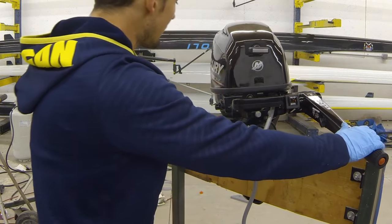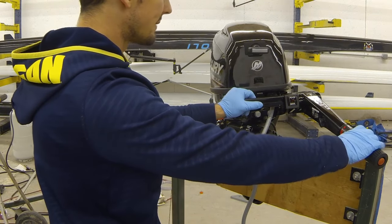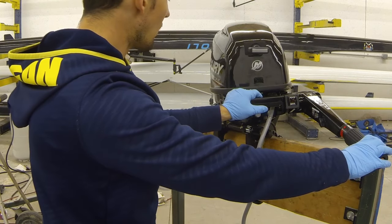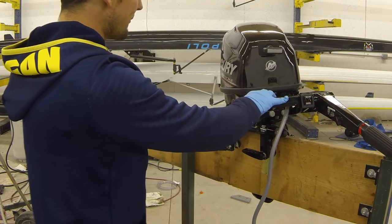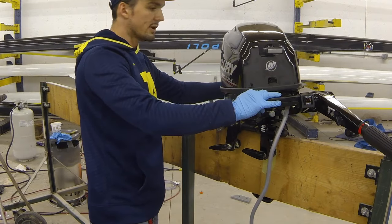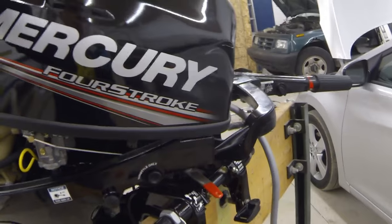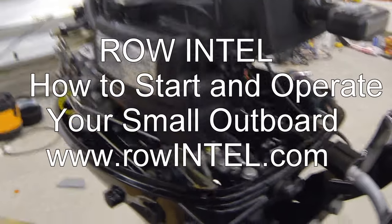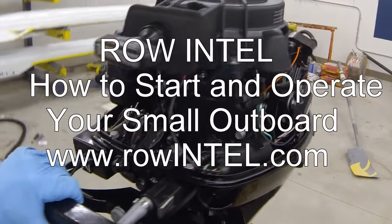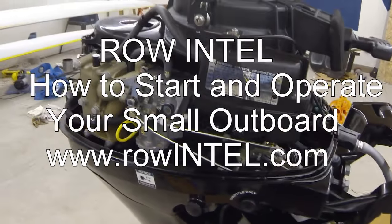So that's the basics of it. For some more advanced videos, you can click on the link inside here and look at other ways if you have a stubborn motor that's not starting up, or if you suspect some issues, check out our Boatman section to repair these motors. If you want to look official, you can pop off the cover — come around the back side of the motor, lift up on the latch backwards and twist it up so it's free, then lift up and push forward on the cowling to remove it and get at all the mechanical stuff. A lot of this looks really complicated but it's pretty simple, and if you check out our Boatman section, there are a lot more good videos that help explain all this. Hopefully you found this one helpful and good luck to you.